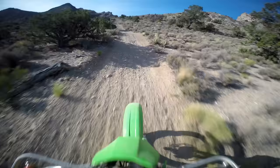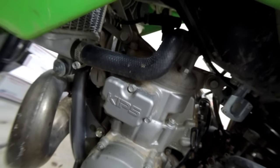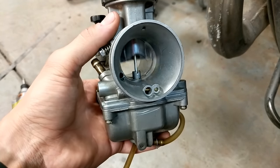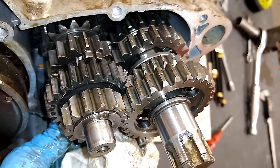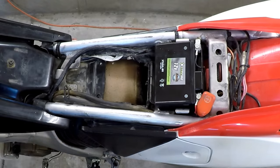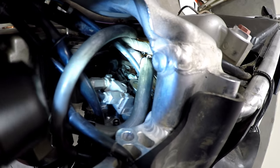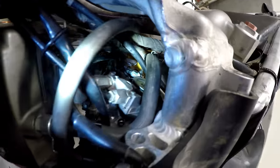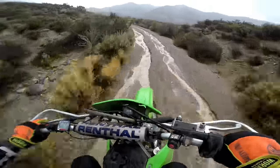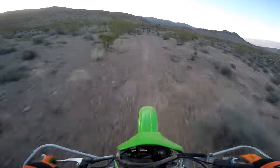Moving on to the engine, transmission, and fuel efficiency. The engine is a 198cc liquid-cooled, premix-burning, KIPS power valve two-stroke, with a 35mm PWK-series D-slide carburetor and a 6-speed transmission. In every other case for these in-depth reviews, various uncorking mods, de-smogging mods, airbox mods, or carburetor mods were needed to get the bike to run correctly. In the KDX200's case, all it took was getting the two jets sized correctly, and then the bike ran absolutely beautifully — just like that. So getting this bike running perfectly has been easier than any other bike I've reviewed.